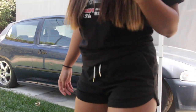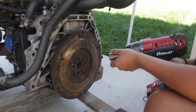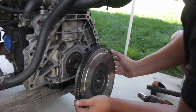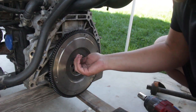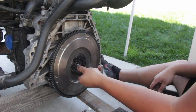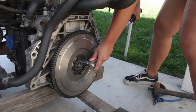I don't know what I'm doing — Daniel is supervising and helping me today. Now that the old flywheel is off, I had Daniel help me put the new one on. Once the mounting bolts were all lubricated, I went ahead and torqued them down to 90 ft-lbs. Off camera I did do 30 and 60 ft-lbs beforehand as well.